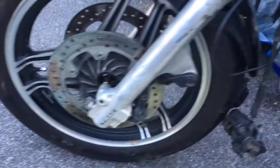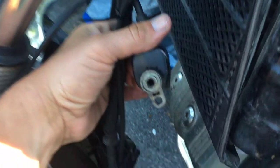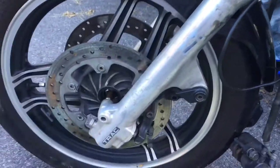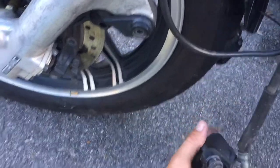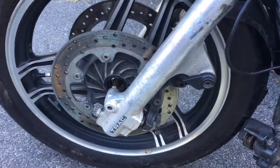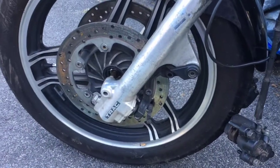If I install this and it doesn't work I'll put the old cable back, but I don't see why this cable wouldn't work. Here's the other end that fits into the gear, and the screws are up here — that just screws right into the bottom. I need to take the axle back out. The brakes are off because these are almost new brake pads, and I have to compress the pistons to get the rotors back in on both sides. I'm going to jack it up using the crash bar, get this in the air, and pull the axle out.